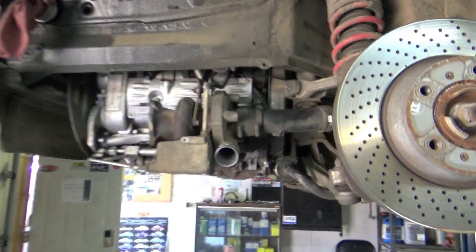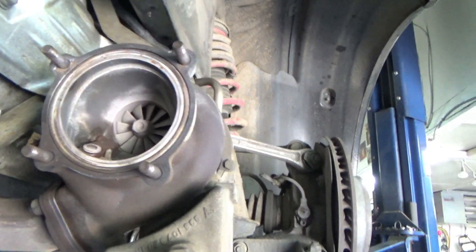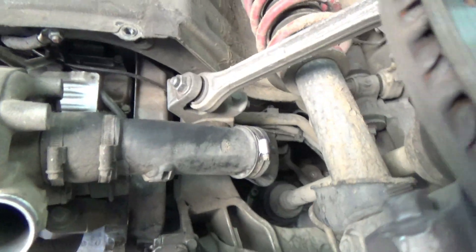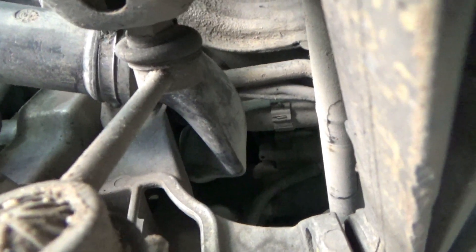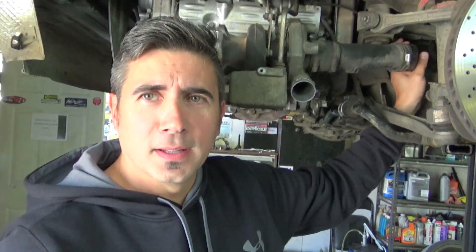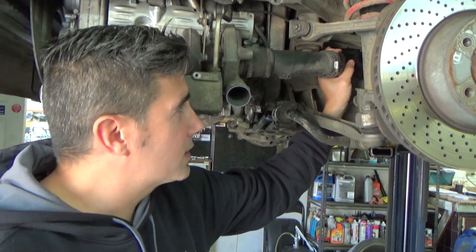Let's look at the turbos. Here is a factory turbocharger from the 996 turbo — for this first stage we're going to leave it alone. There are some performance killers in this car, some of which are in the intercooler piping. If you follow this turbo down and look at the intercooler pipe, look at how flat it is — that's useless. You're going from a round pipe into something relatively flat. That flat piping kills performance; on these factory 996 turbos that's where a major bottleneck exists.